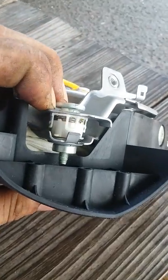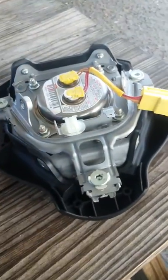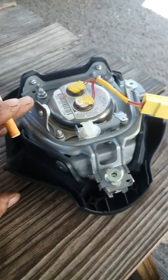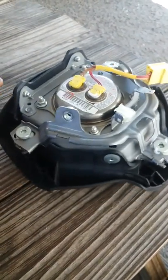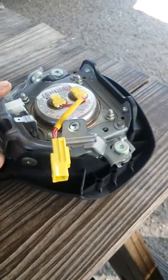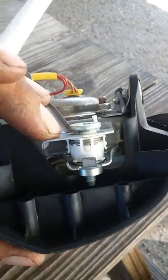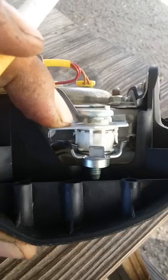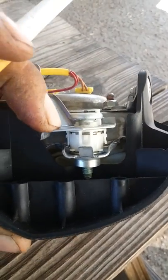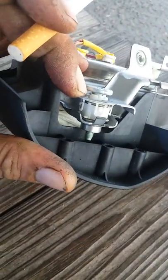This is on a 2008 Lancer ES. I went ahead and floated it all back up before making the video, and sure enough it works — you press the horn and it functions as it should. You just want to bend these tabs back out right here and make sure you've got a good square surface where it's even, so the screw ain't cocked over. When it gets cocked over, it shorts out the circuit and your horn gets stuck, starts blowing.